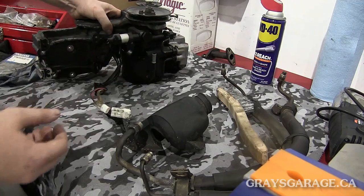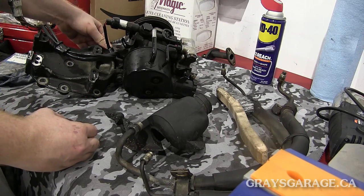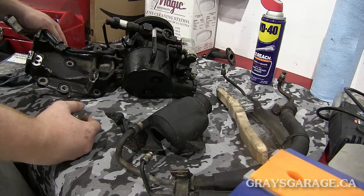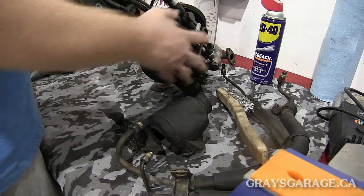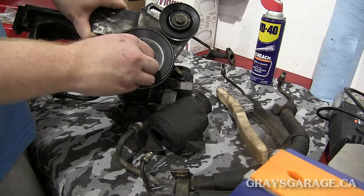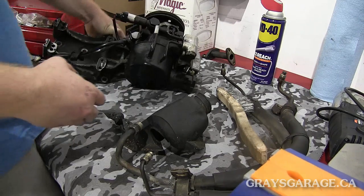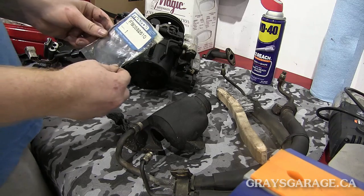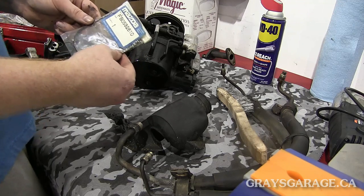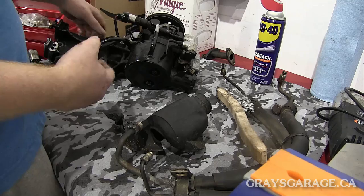The pump comes off with the aluminum bracket — you can see it here. The oil will leak, it's quite messy, so you can either work on it with the pump still on the bracket or take it off. I'm going to take it off, and I believe the first step is to take the pulley off using an impact gun. The only rebuild you need is three o-rings, so it's fairly simple — about ten dollars. The procedure is to get it off, clean it, put the new o-rings in, and put it back together.